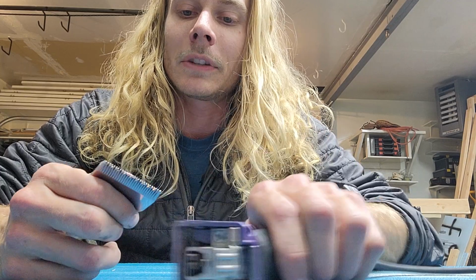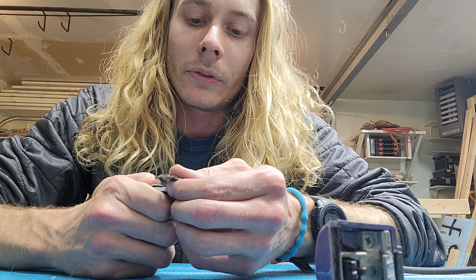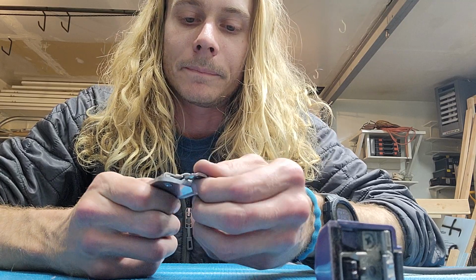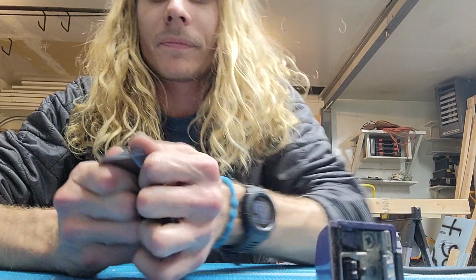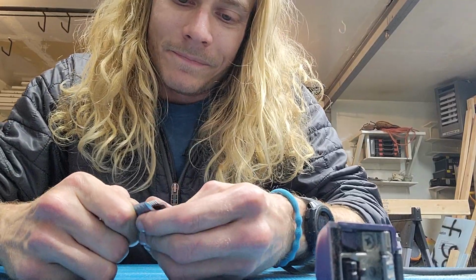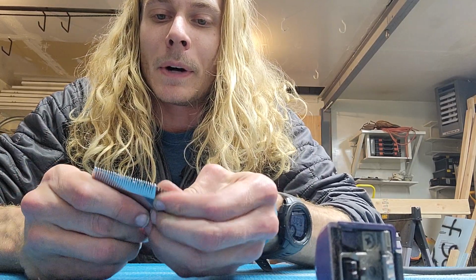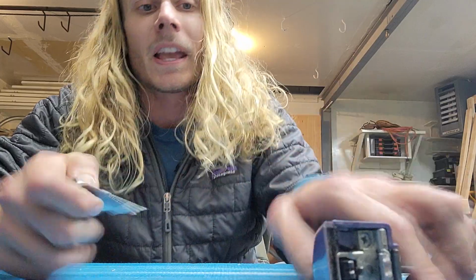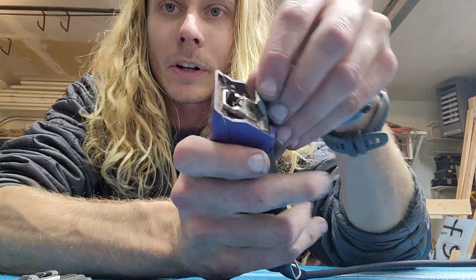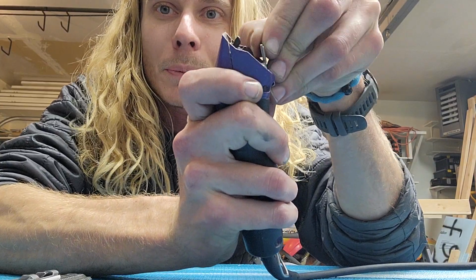And then I took a look at the blades and they are way overdue for sharpening. So if you look, let me slide, and it's kind of tight here. They cleaned out all their blades beautifully. There's no hair or red stuff on them, but I can tell they weren't oiling enough because of the clipper. And the other thing is I noticed this clipper also has kind of a wiggly hinge there. You can see it moving. So we're probably going to replace that.